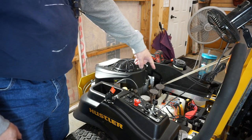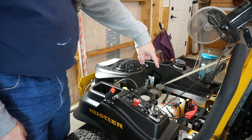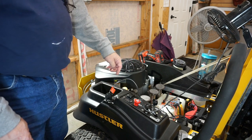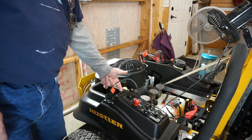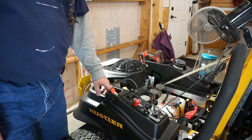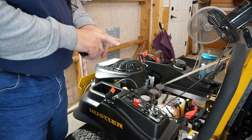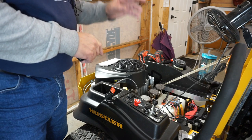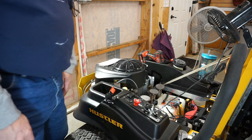So the two-wire connector plug, the hot wire comes up to the connector plug. The ground comes up to the connector plug. Out of the opposite side of the connector plug comes over, and we tie the ground wire to this and to this through the single connector of the switch by utilizing a Y system and then soldering and crimping together. And we did both. We soldered and crimped, and then we used two layers of heat shrink on it. So it's in pretty good shape.